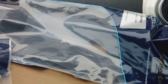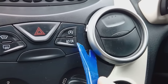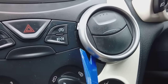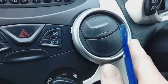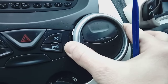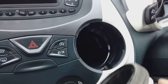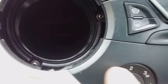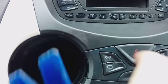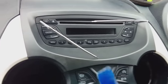To remove the radio, the first thing you want to do is get your little plastic pry bar and put it underneath these little rotating vents, under the chrome bit here. Gently ease it out — you'll notice the locating clips: one here, one underneath, one on each side. It will pop forward a couple of millimeters. Then just rotate it a little bit and pull it out. The vent has got a lip, so you've got to remove these two vents to get the radio out. It's a rotate sort of fit, so just spin it round and pull it out — it'll come out very easily.